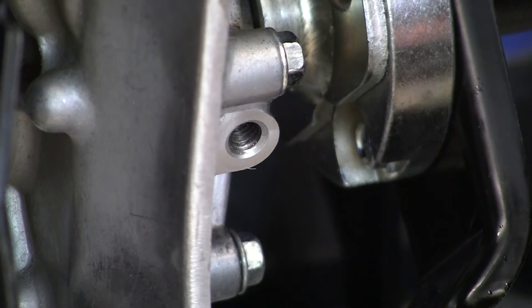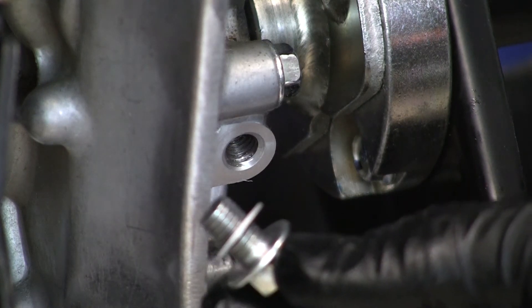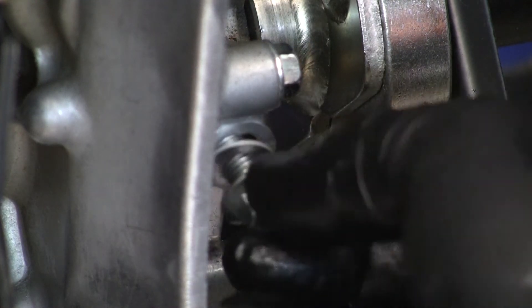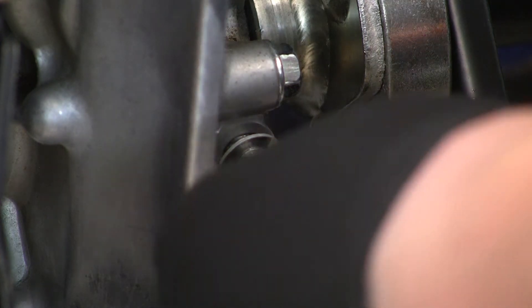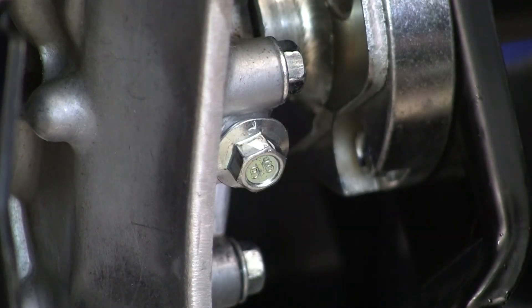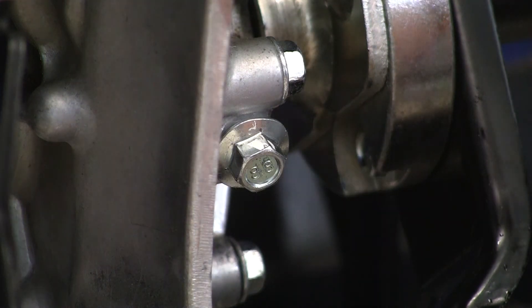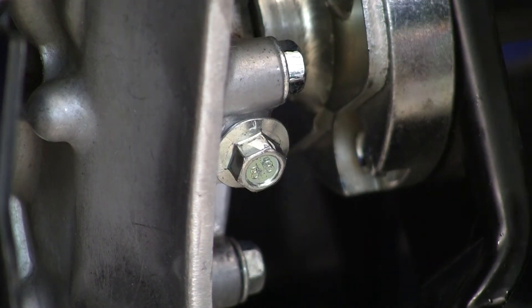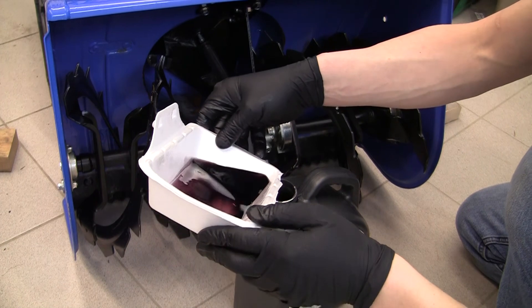Just got to make sure it's in fact full. When you think it's full, we've got an aluminum washer on here - stick that back in the hole and torque it to 139 inch-pounds. Now I ran out of 10W-30 Royal Purple so I ended up using a 10W-40 just to finish the job, because it will be fine. It does seem rather tight for this size of bolt, but I always initially trust the Yamaha engineer. If I get screwed once, well, never again.